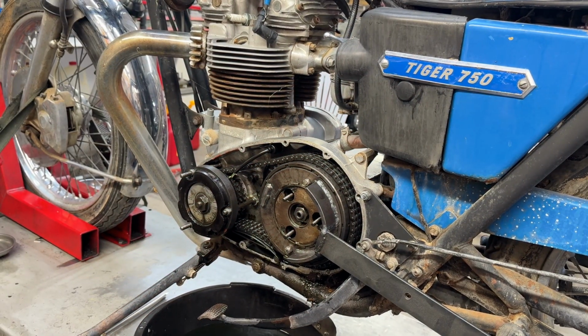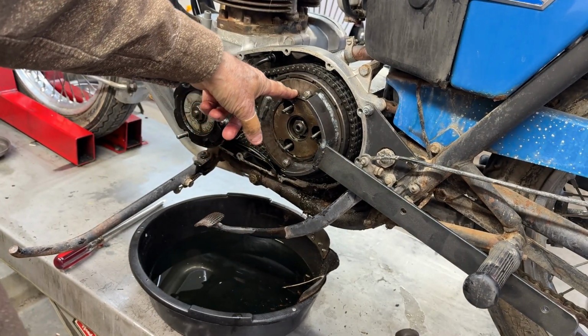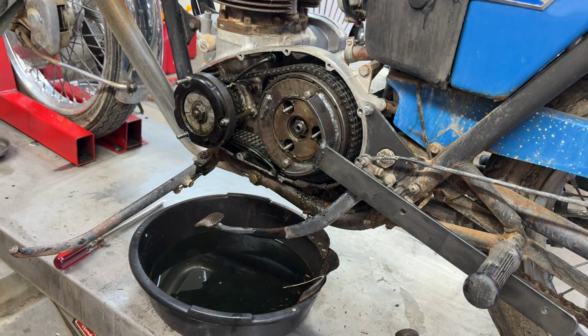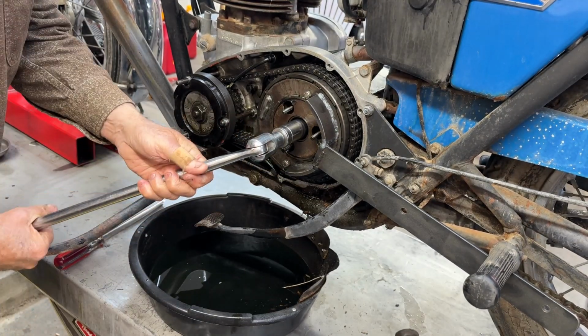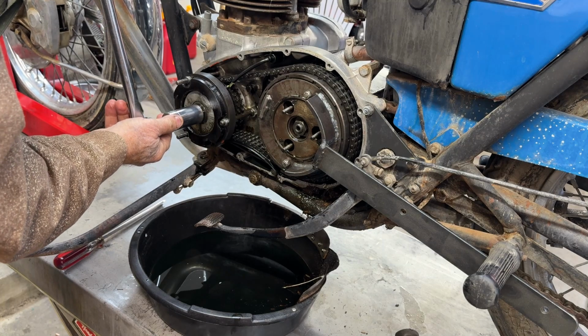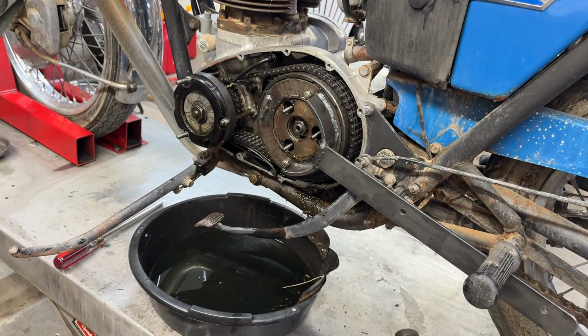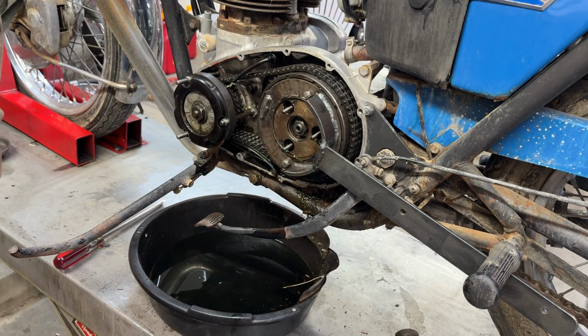All right, just another special tool, in case you're interested. It's this guy. It's two clutch plates welded together and welded with a big arm, so it locks the whole clutch assembly, so I can undo the center bolt, which I've already broken free, by the way. I did that, and then I said to myself I should video this, and so I'm now videoing it, even though I've already broken both of these free, because I had this guy to lock that and jam itself underneath there to keep it from turning. And sorry I didn't videotape the original. I should have.